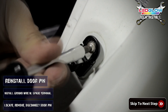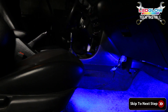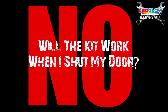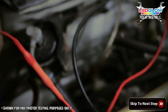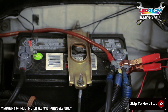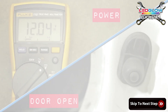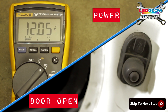Once you have completed this version of the installation, your interior lighting kit will illuminate when you open your programmed driver's door. If you enable the auto illumination feature, you will not be able to power the interior lighting kit if your door is closed. By installing the interior kit this way, it is ground controlled, so the kit will not be powered when the door is shut.